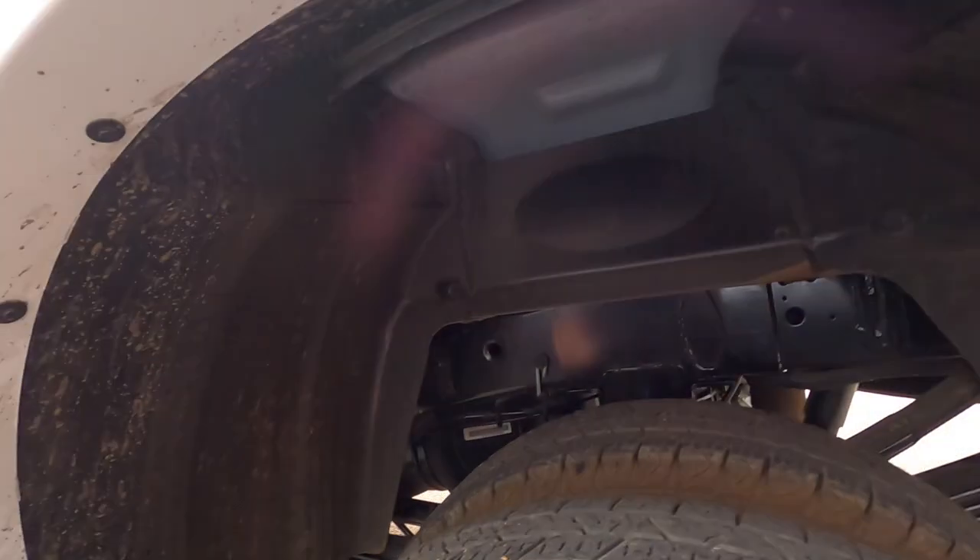There's a major, major difference in how it rides. I'm going to go back to the shop, then go back to the yard and see if it's leaking any — just shut the truck down and listen quietly. It's going to be nice once we hook it up to the trailer. It's going to sag about two inches, but when it sags two inches the truck sits level because of the tow package — it naturally sits higher in the rear. Put a heavy load on the front of the trailer and it sags even more. Super excited to tow with it.